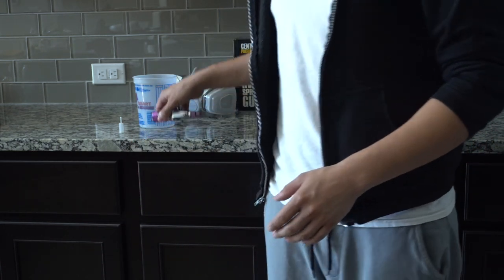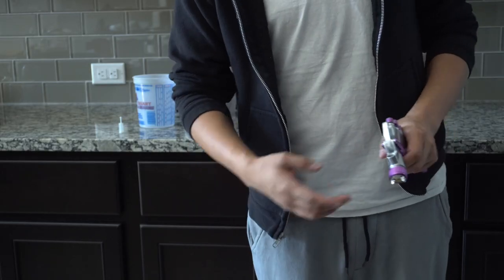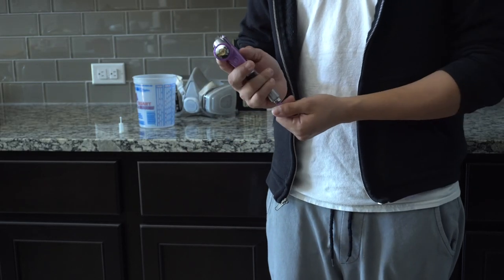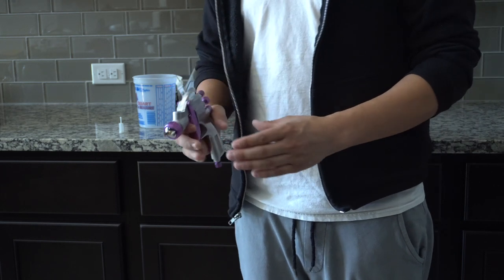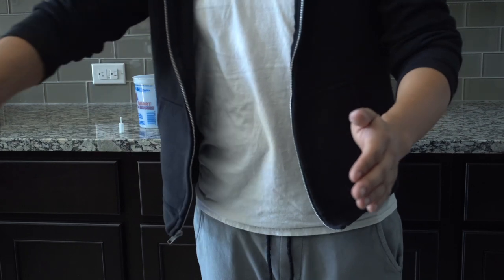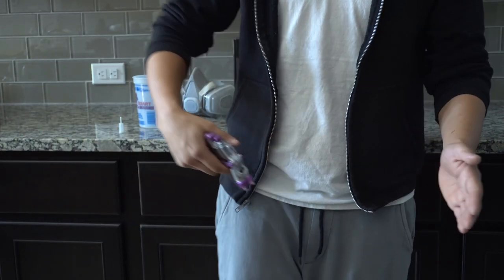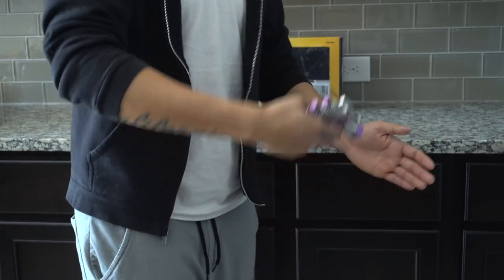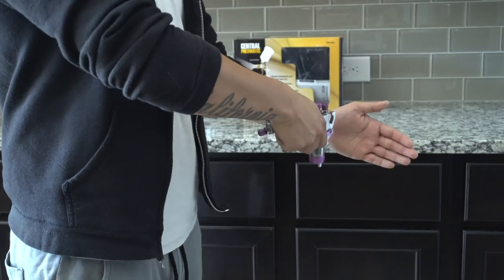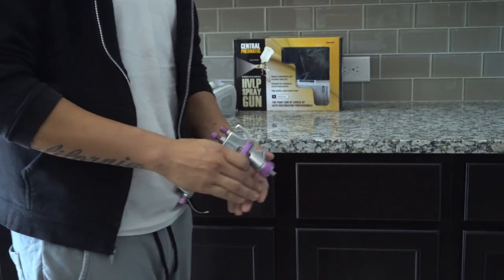Now, if you're having issues with tiger stripes, which I sometimes do, more than likely it's going to be the roof where you get tiger stripes. What you want to do is close up your fan to where you just get a small wet spot, and start at the middle, and then keep dragging that small wet line back closer to you. You don't want to go to the other side of the vehicle. You start off halfway to where that last wet spot was and keep dragging that edge all the way towards you. And that's going to eliminate any tiger stripes.